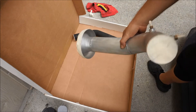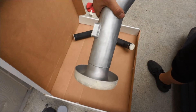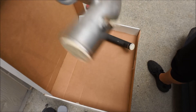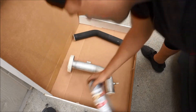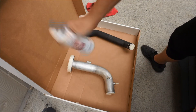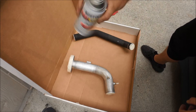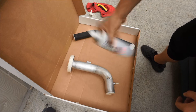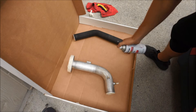I've taped everything off — look at these lines, they're really good. You can see it's gonna look like a nice square block. Great taping job. Now for the primer step, since we sanded it, it's really ready. I'm doing this because I think it gives the best adhesion instead of going straight to wrinkle black. So we're gonna go ahead and throw this primer on there.